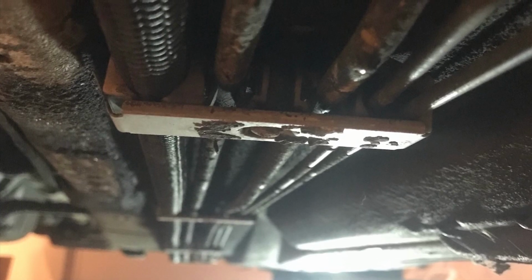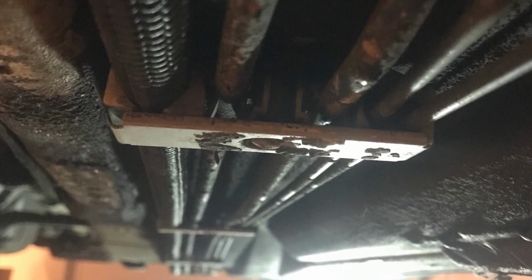So, now that the engine's out, I need to start getting prepared to put the LS engine in. First thing I'm going to tackle here is the fuel system. I first started by ripping out all of the old fuel lines, but kept all the brackets intact from where they came out, because that was exactly where I'm going to run the new fuel line. The problem with this is actually getting it up and across the tank.